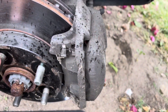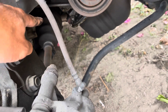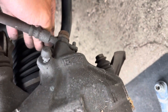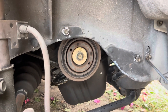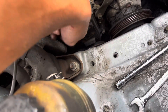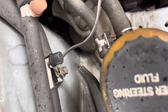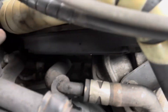Happy to see the brake pads still have some life and the rotors look new. The CV axle looks good, boots look fine — I'm sure these are original Toyota parts and they're holding up well. Gotta get the motor mounts off, about two bolts under there. This power steering line or AC line kind of gets in the way.